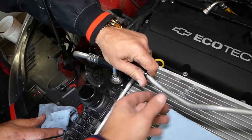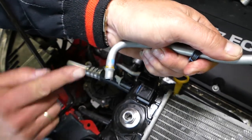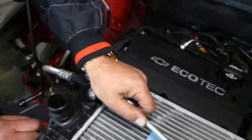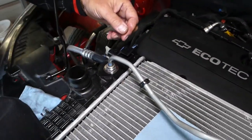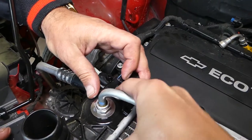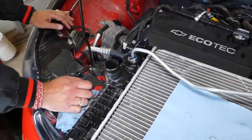When you reinstall it, make sure you push the line all the way in. The locking spring goes on top right here — if it's on the other side, the line will come loose and you will lose your transmission. Push it all the way in, install the spring, and before you install the plastic cover, wiggle it to make sure everything is good. You can actually see the lip — everything's perfect — then install your plastic safety clip.